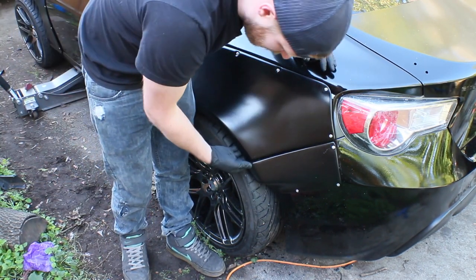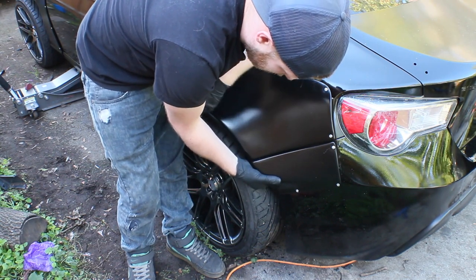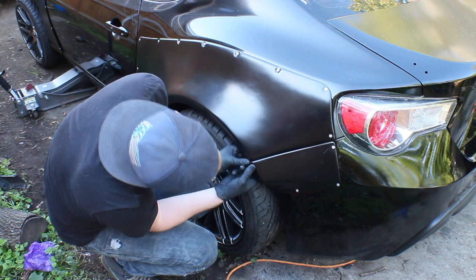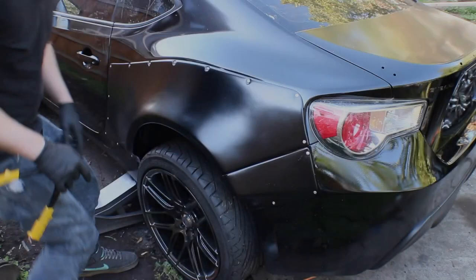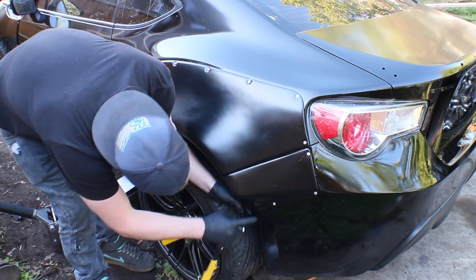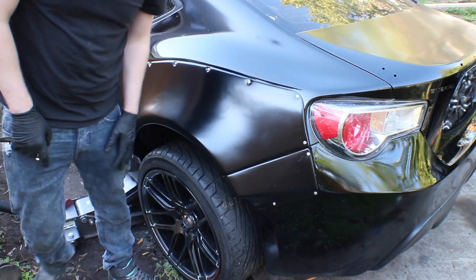So this little back end is flared out too. Off camera I'm going to think up a nice way to attach these down. I can drill it into the side of the bumper here, but then it's going to be just as flimsy. I'd like to attach it to the kit itself — I might come up through the bottom and drill up through here and attach those pieces together. That'd be a little bit sturdier. To solve this piece sticking out too much, what I did was on the inner fender well I drilled a hole through the Rocket Bunny piece into the bumper on the inside, drilled the hole straight through, tucked this in, and then shot a rivet through the back of it. So that'll hold that on — I'm going to do that to the other side and then we're all wrapped up.